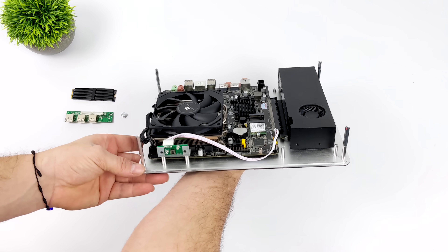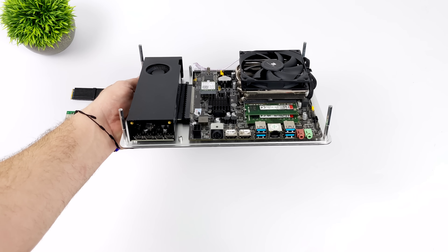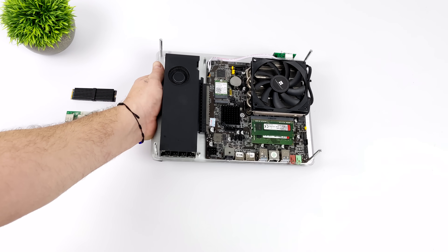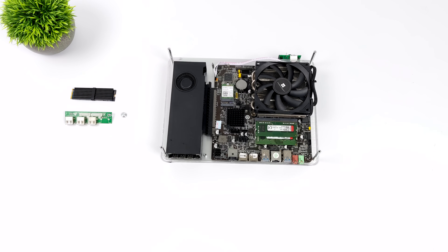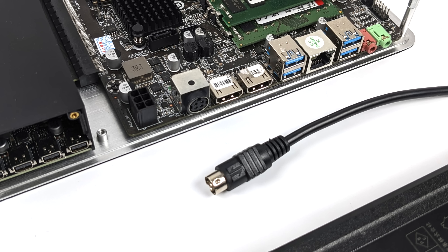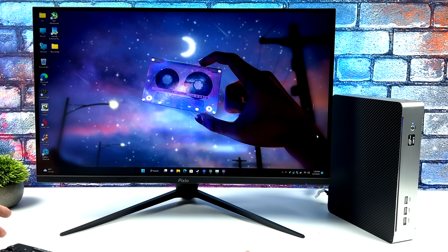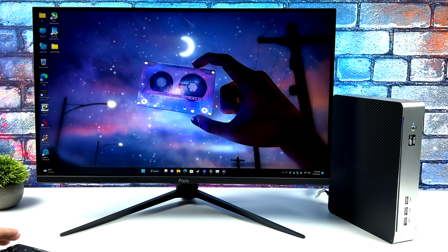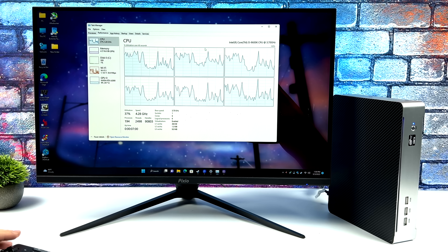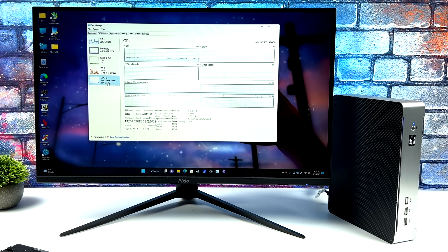Once it's all taken apart, we've got a PC platter with the GPU, motherboard, RAM, SSD, CPU, and cooler all mounted right there. I've got 16 gigabytes of RAM and a 1 terabyte NVMe SSD installed. There's no power supply inside the case — it uses an external 4-pin PSU. I've got a 280-watt PSU, which supplies plenty of power for the A2000 and the 9600K. The A2000 draws power only from the PCIe slot, pulling up to around 71–72 watts fully maxed out. The 9600K TDP is set to 90 watts, which is right where I want to be given the cooler and form factor.